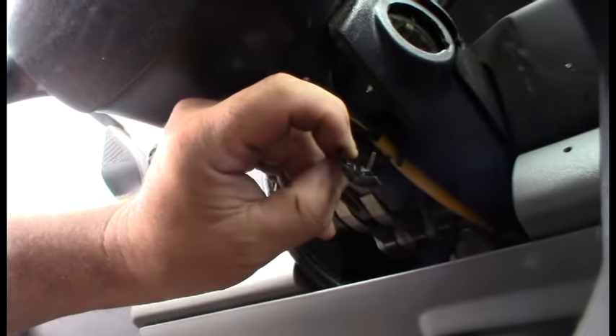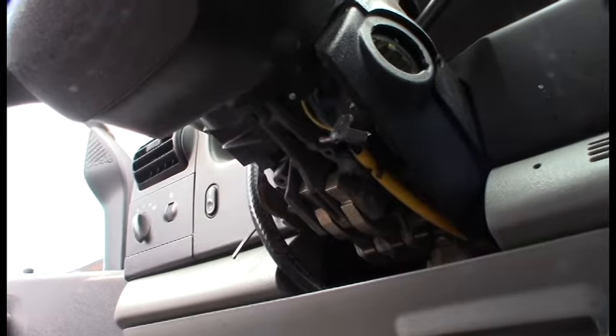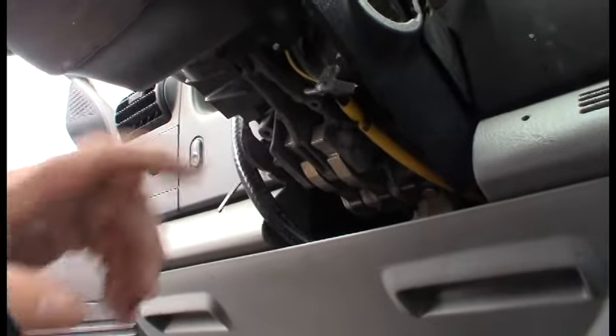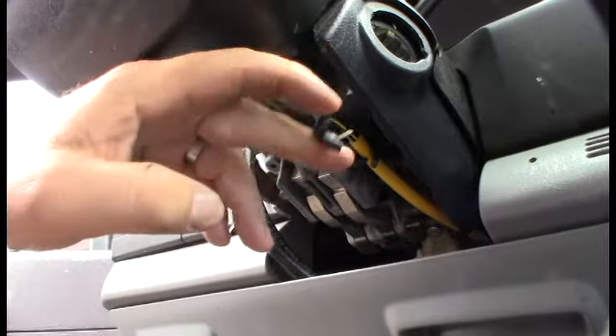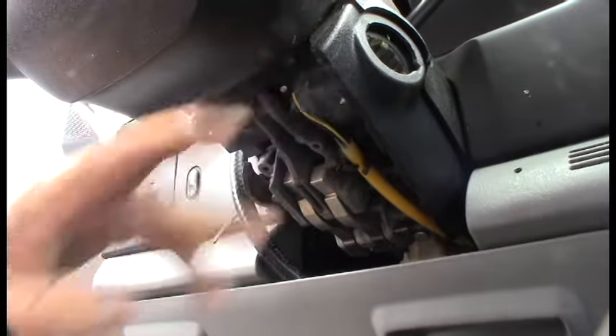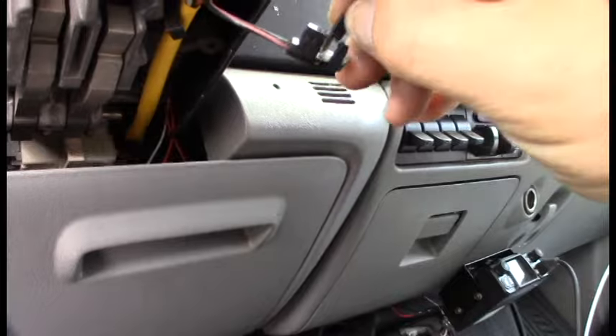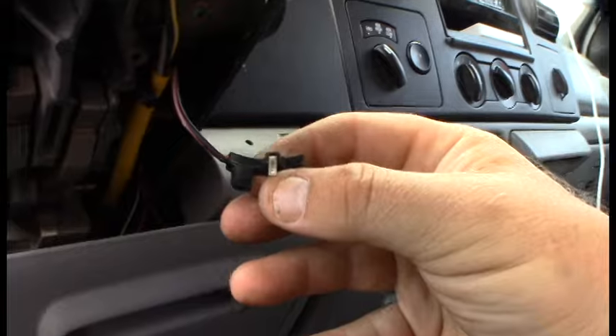You can see there's a wire in there. There it is — that's what fell off the back of the ignition switch. This normally wouldn't bother me, but I think it's preventing my tuner from going into programming mode because I keep getting this error code. It won't clear because every time I turn it back on I get the code again. The cause of the problem is this little tab coming off.